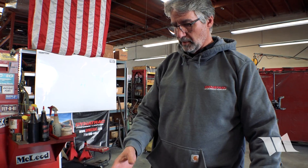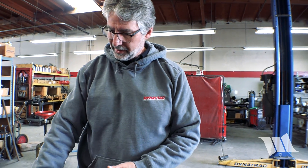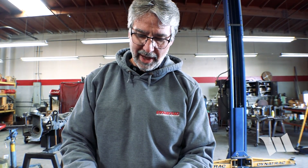For those of you with a Rubicon, the gear sets that come in them are actually pretty big — the M210 gears are about the same size. We decided to stay with the JK gear set for the Pro Rock 44 because we've had no failures, even in heavier cars with guys running big tires, deep gear ratios, and Rubicons. The Avantech gear is a good gear, but there's really only one supplier. This gear is available from Dana, other US suppliers, and import suppliers. We're very selective and happy with the performance, quiet running, clean setup, and good patterns — there was no compelling reason to change.